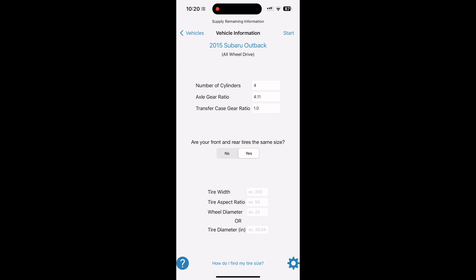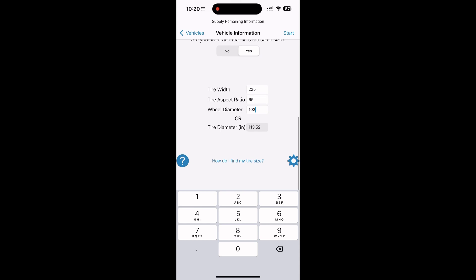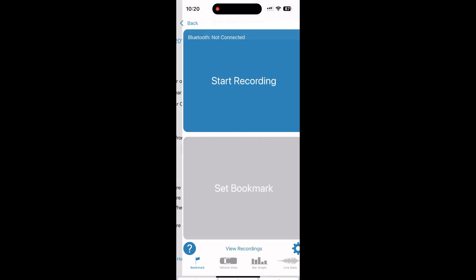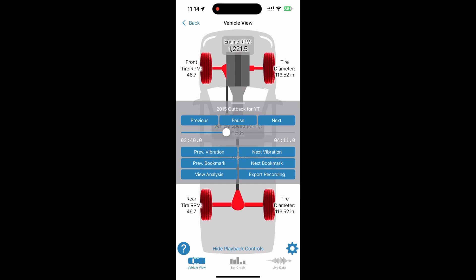You can make a minor tweak to the engine if you want, but I wouldn't touch anything if you don't know what you're doing — trust the app. You'll also be given the option to select if you have different tires in the rear, like on a muscle car. After that, enter all the information from the sidewall of the tires. This is a garbage-in, garbage-out device, so don't get it wrong. When it's set up, select 'Start Recording,' put the phone in the secure location, and go on your test drive.